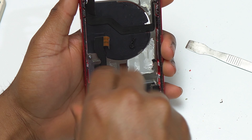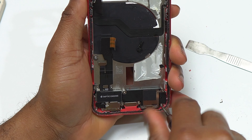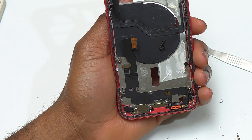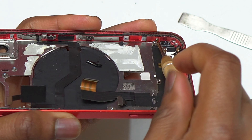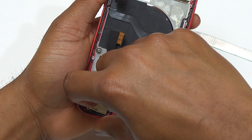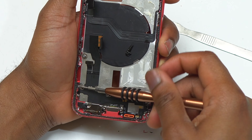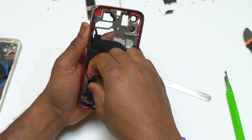I then moved to the bottom of the device to remove those components. I didn't remove the flex cable for the volume buttons or the wireless charging because those are already installed in the replacement body I purchased. Also, a recommendation: if you purchase a replacement body for your iPhone 12, get the one with the small components already installed — this saves time. You can get bodies for the iPhone 11, 13, and 14 with small components already installed.